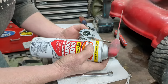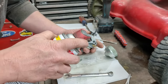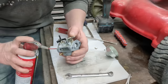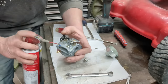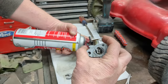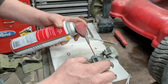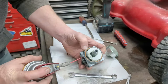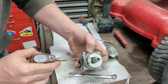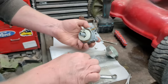The way you test it is simple — carburetor cleaner, not WD-40, not brake cleaner. Carburetor cleaner is essentially acetone with some other things, but acetone is what breaks down bad fuel. I'm just going to stick it into the air jet at the front and bring it around to the back. Wear some safety glasses and don't spray it in your eye. I can just spray it through those passages and make sure they're all working. It also picks up fuel off the bottom through this little Phillips screw here. When I'm spraying through there, I should also see some coming out the bottom. I'm getting barely any — so I might be clogged from going down to up. We can take out this Phillips screw and check that passage as well.